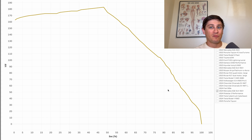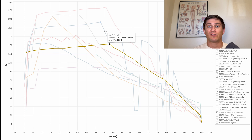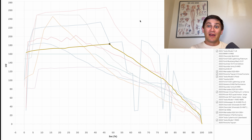Let's put this in context with some competitors. I've included a lot of competition — both crossovers and SUVs. The just-about 180 kilowatt peak is not particularly impressive; several vehicles reach well over 200 kilowatts — the Mercedes EQS, Tesla Model Y, the Model S, EGMP vehicles. However, the impressive part is in the 40 to 80% range. It's not the best charging vehicle but it's definitely near the top. It's bested by EGMP vehicles and the Porsche Taycan, but those are some of the best charging vehicles on the market. It's really quite a good curve even if the peak isn't super high.